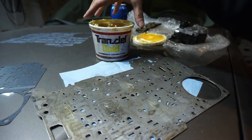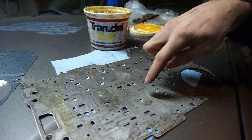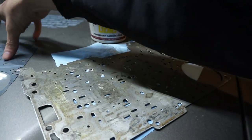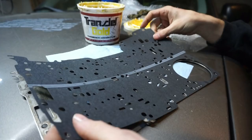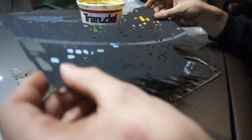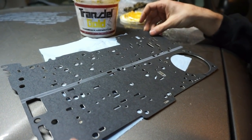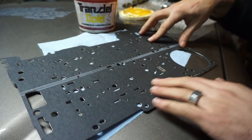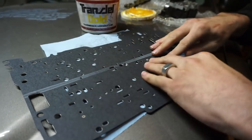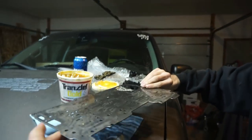Do the same to the other side. I'm just using this transmission assembly lube and I put a couple dabs on — you can see all around the separator plate. Now I'll take the gasket and just use this to stick it down. The assembly lube will hold it in position until I'm able to flip it over on top of the valve body and screw it back down. You can see now it's kind of attached — it's not going anywhere.